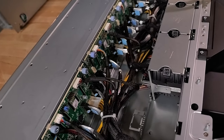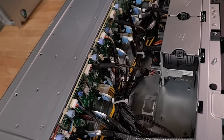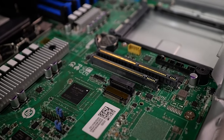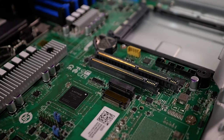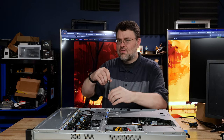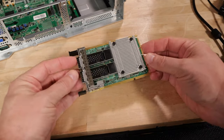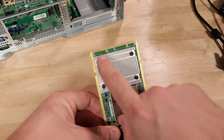I mean, a single socket, 128 PCIe lanes, there's almost not enough PCIe lanes if you do the math. You get 24 bays times 4 lanes, that's 100 lanes by itself, almost. And then you've got 2 more, and then you've got your OCP slot and your other expansion slot, and you're basically out of lanes. And while you do have the x8 slot, again, my recommendation is you put the 100 gig, 200 gig, 400 gig InfiniBand, Ethernet card, OmniPath, if you're a crazy person like me, Nick, in your machine.